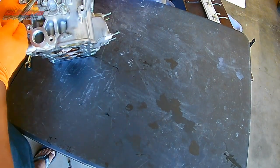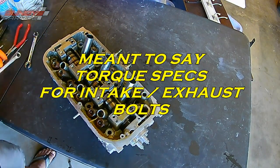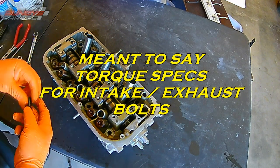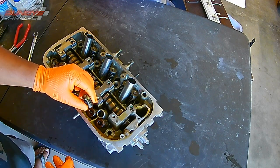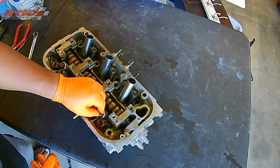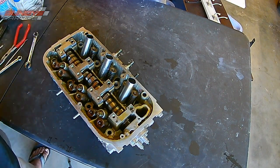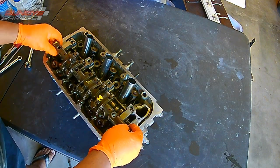Just tightening those down — those are 12-millimeter bolts. I'll put specs for the intake and the exhaust cams in the description. Those are springs — the little steel plate actually faces upwards. Those are used for VTEC. Those springs are used when the VTEC kicks in. Just felt the VTEC kick in, yo.